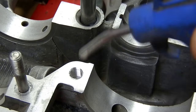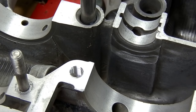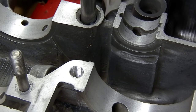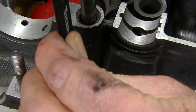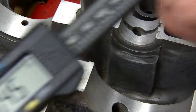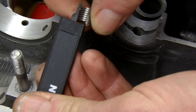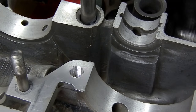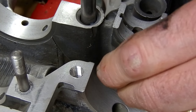You can probably see in the camera I'm going to have a really nice thread cut in there now. It's pretty deep - I'm just going to check with a mic to see how deep it is so I know how far to place my helicoil or if I have to go deeper. It's looking like I'm a little bit deeper than the helicoil right now, so I can position it where I want to. I'm down pretty deep in the meat of the block there, and that's kind of where I want to be.